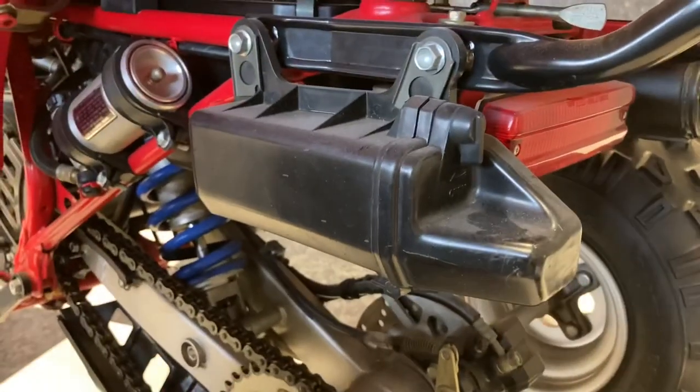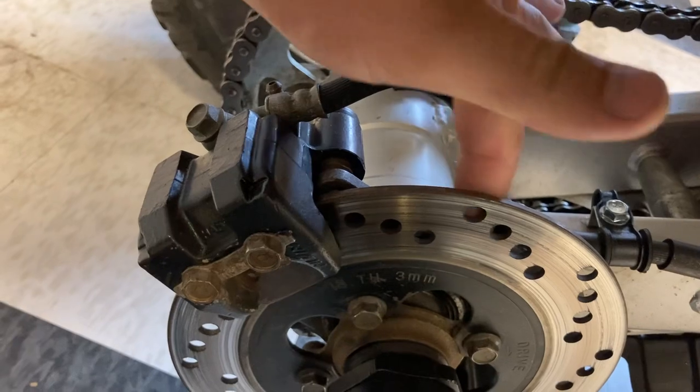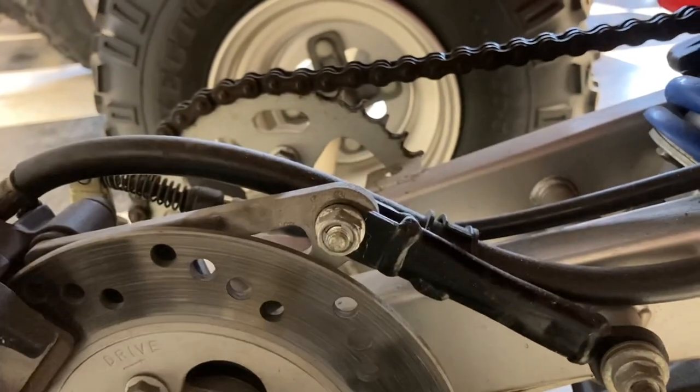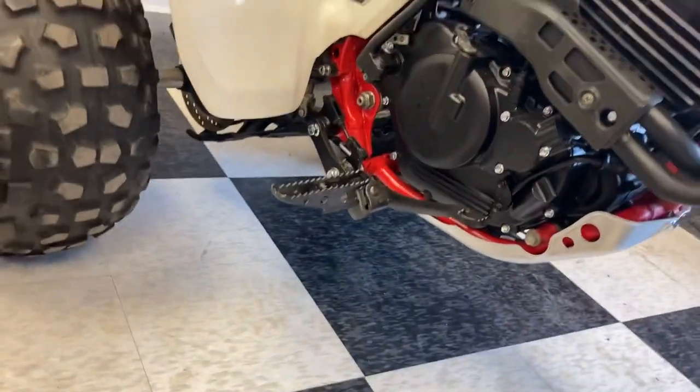Toolboxes are in the same situation: the '85 has an elongated toolbox that looks very similar except for different lids — this one flat square, a little different. Rear sprocket setups are almost the same, but the rear brakes are different again. The '86 has a brake setup where the brake rides on a slide on the swingarm. The '85 has a very different setup with an elongated arm that goes to the swingarm. Exhausts are almost identical. Wheels are a bit different — the '85 wheels are a clean plain style front and rear.